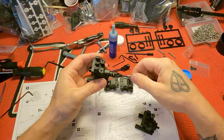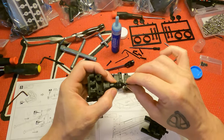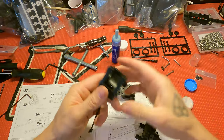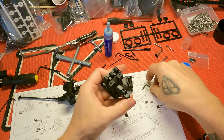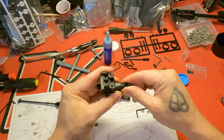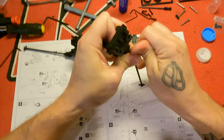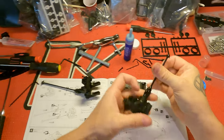It should spin freely without feeling really gritty — if it's gritty and making a lot of noise you probably have it too tight. If you hold the drive shaft you'll get a little slop in the joint, but if you hold the joint itself you don't want any play — you don't want that gear going in and out because that will mess with your backlash. Now that you've got the rear one done, set it to the side and do the front one the same way. Once you get it tight, check it again — that's butter, which is what you want.